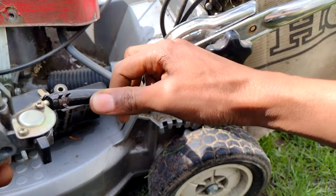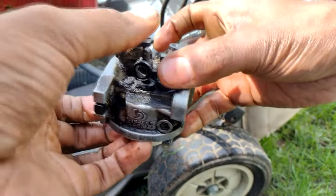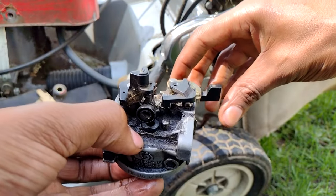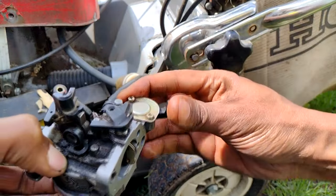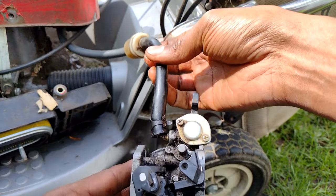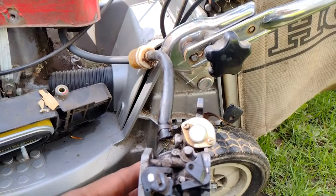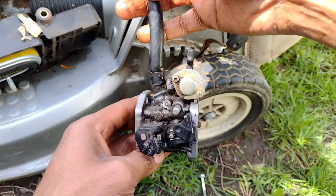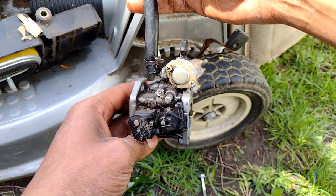Okay. Alright. Now we're gonna see. I got the float. I'm gonna hold the float up like that, and we're gonna see if it pours. Because if it does pour through, that means the float, I mean the seat, is compromised. Push this over. Alright, we're gonna see if the seat's compromised. Sorry, I gotta keep going everywhere with angles here. Just gonna put it up sideways. Because I already know I gotta order parts for this and I gotta cut this yard.